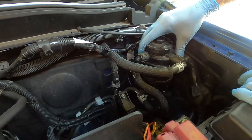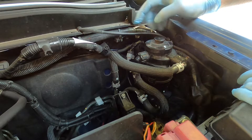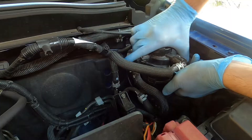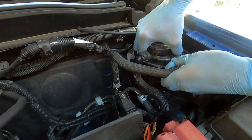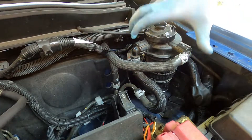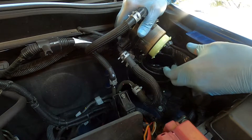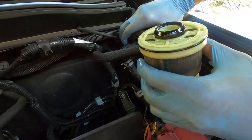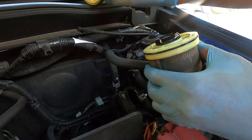We're under our fuel filter at the back of the engine bay. You've got your primer pump on top - this is what we need to pump once we put the new filter in. There's a big ring on the bottom - undo it by hand, wind it down until it goes loose, then wiggle it because there's a seal in there. Up it pops and there's your fuel filter - you can see it's pretty dirty, it's done its job taking all the crap out of the fuel. Wiggle it down, you'll get plenty of diesel leaking out everywhere, then straight in the bin.